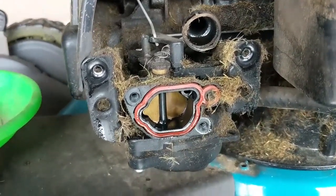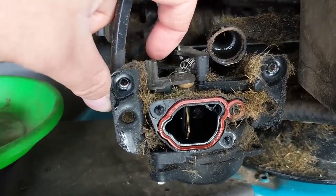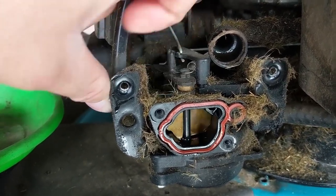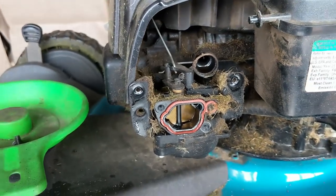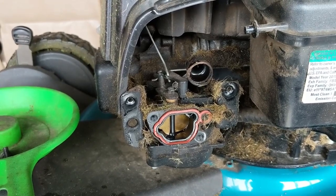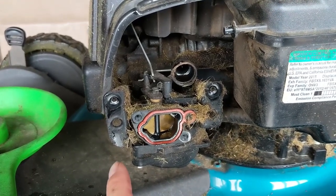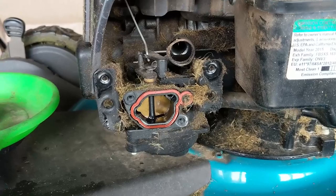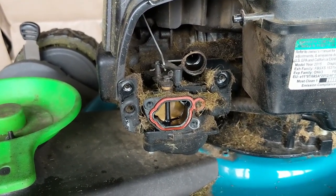While we're here, we might as well fix the little sticking choke issue. It does plague these engines, but this one isn't as bad — it's not sticking at all, but I can go ahead and file that down. If you guys haven't watched that video, I'll link it in the top right of your screen and in the description below. It's about five minutes and covers fixing that issue — it's a design flaw from Briggs and Stratton. But we're going to go ahead and remove this carburetor.